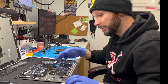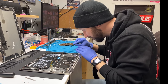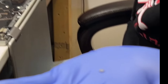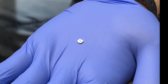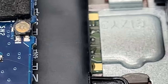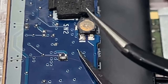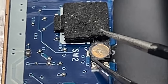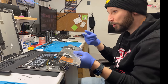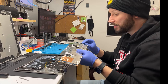And I couldn't find it. I was like, well, where is it? Then as I'm looking inside the laptop, I see this microscopic piece of metal. It's super hard to see. So the most important component of this laptop is reliant on this piece of switch that's made of cheap aluminum, and it's attached to cheap plastic that you can see is so brittle — it's actually deteriorating on the power button itself. This is the most commonly used component; you press this power button thousands of times during the laptop's usage and this plastic is so brittle.